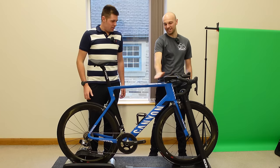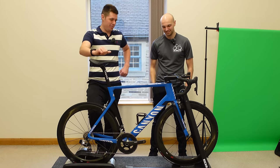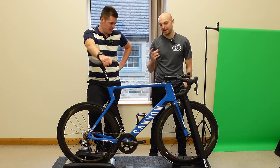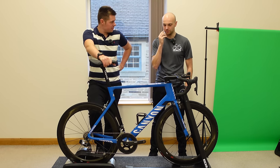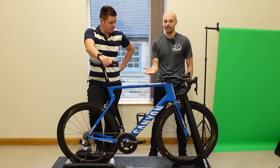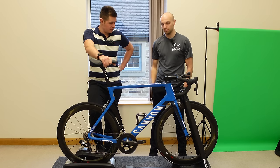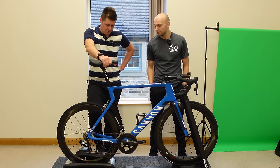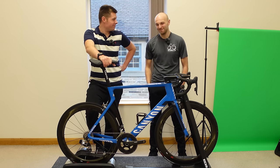The other thing is the cut steerer. Canyon did that — I bought a bike with a chopped steerer tube. Buying second-hand bikes with chopped steerers means you've got to be very specific with your frame geometry and make sure you'll never need that extra height, because if you need it and you haven't got it, it's either buying a new fork or just suffering a bad fit. So I probably don't approve of that either. Thanks very much, Dan — really appreciate it. No problem, pleasure.